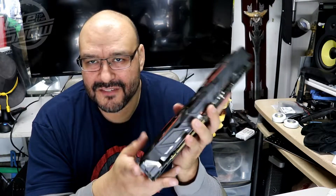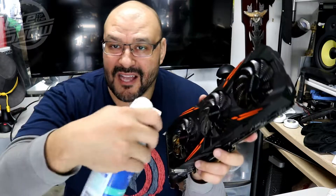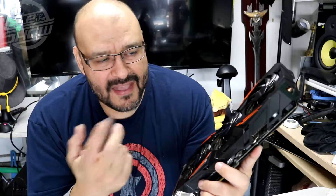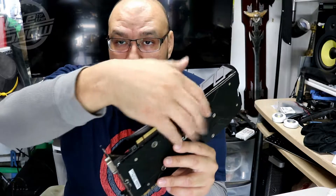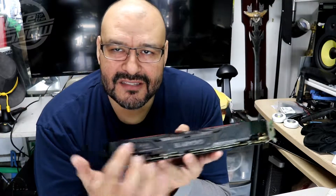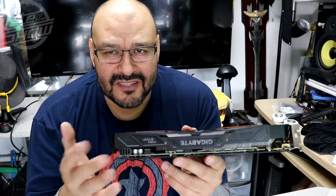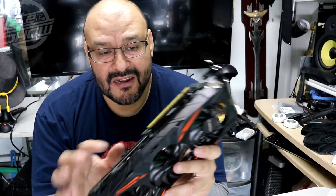These things are very expensive — almost a thousand bucks for some of them. This is a GTX 1080, a very expensive large video card. If you keep gaming and burning it out, you've got to do maintenance. At minimum, take it out and blow some air on it. Make sure all three fans are running and check their connections to the GPU board. Also, the LED light on the GPU indicates certain things — red, green, blue — so watch for trouble indicators like overheating.